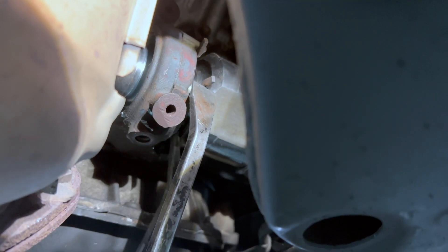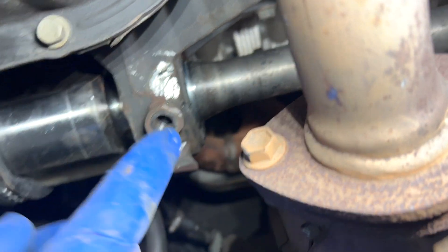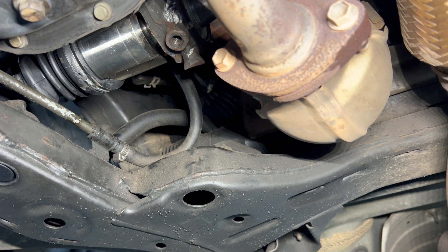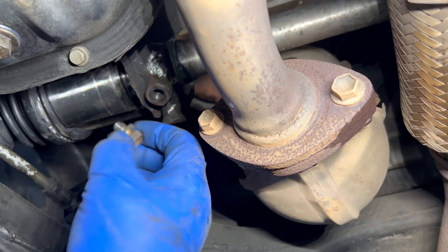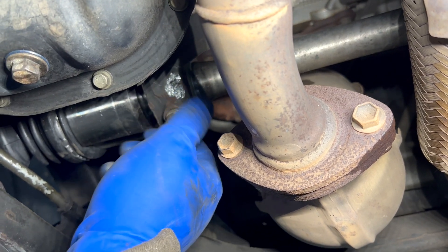Got our axle seated. Now we're going to put the spring clamp back in, then the pinch bolt. There's a little rubber piece that goes on the end of that — sometimes they stick in there, sometimes they come out. This one's just missing altogether. It's kind of old rubber material, old car parts — about three-eighths of an inch long. We shoved it in there, just enough to put a little bit of pressure on that outer race.